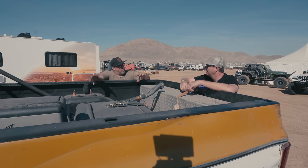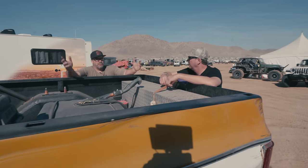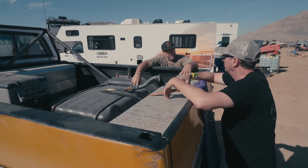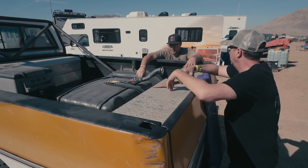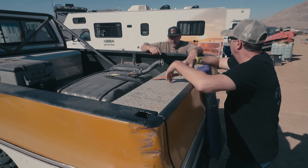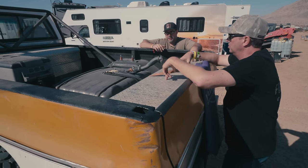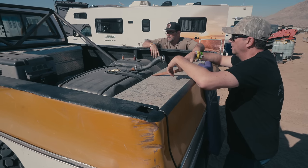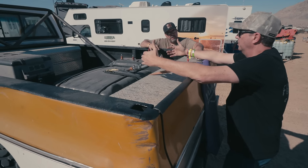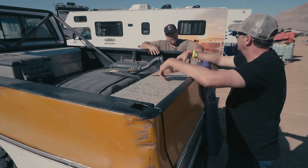The original build was a junkyard build — what you'd throw together as a young kid with cheap parts. There's a suburban tank in the rear with an electric fuel pump, dual Optima batteries, a toolbox with easy access to tools and spare parts, and an electric ice chest. The idea was to get weight to the back — in the snow you want equal weight as much as possible. It's pretty well balanced, probably 60/40.